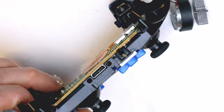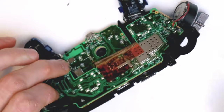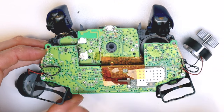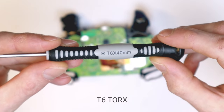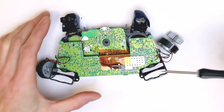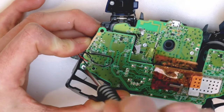The audio jack is not soldered in or anything. To get to it, there are two screws here — pretty easy to undo. You'll need a T6 Torx screwdriver, or a slightly smaller flat-bladed screwdriver than what you used to open the controller. Once those screws are removed, this board comes apart fairly easily.